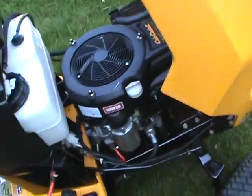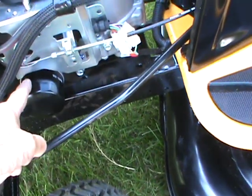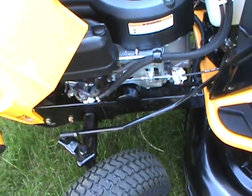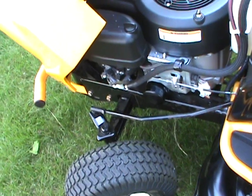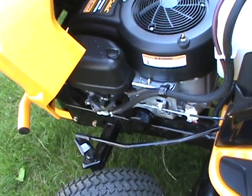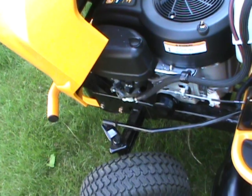This one has a 547cc engine. When you change the oil they give you a hose coming off the bottom here, which makes oil changes easy. On this side they give you an oil filter to take off, located right here — get a good strap wrench and rotate it off the conventional way. When I changed the oil the filter was extremely hard to get off, very tight. I think the problem was there's a coil spring on the inside of the filter. I bought a replacement OEM Cub Cadet filter and it didn't have that feature, so I think that spring is what keeps it really tight — maybe so they can tell if you've changed the oil. That's probably why they put a different type of filter on it when it's new.